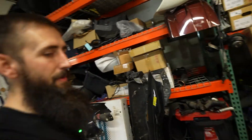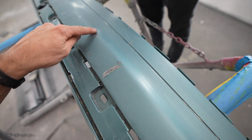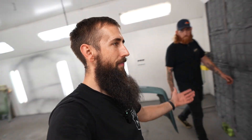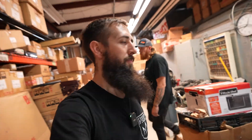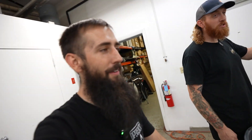This is basically a zero-care car — the bumper's trashed but it'll look better all in one color. The car is red, not green. This is literally just scuff it, shoot it, done. I should spray it for maybe five to ten minutes, let it sit overnight, then pull it out in the sun to bake a little bit more since it's single stage with no clear coat. Mix up some paint, get her sprayed for Grant, then get back to work.